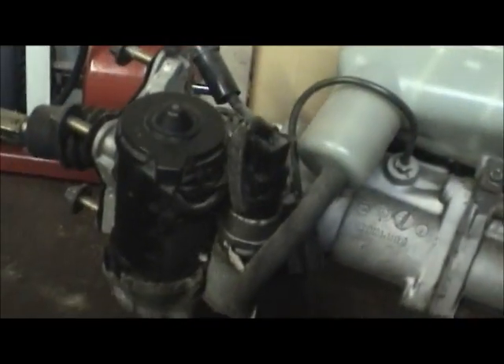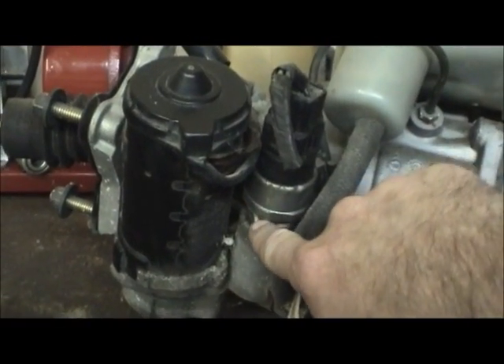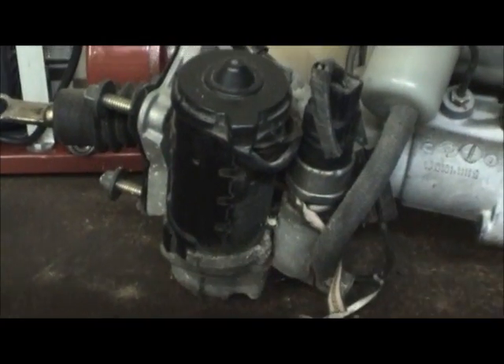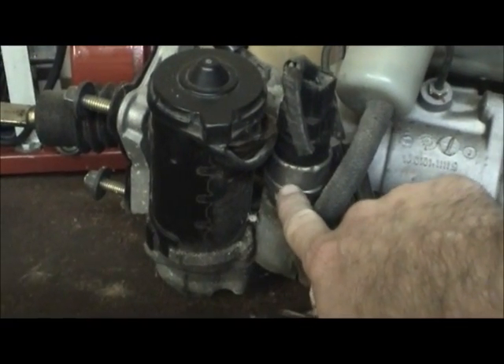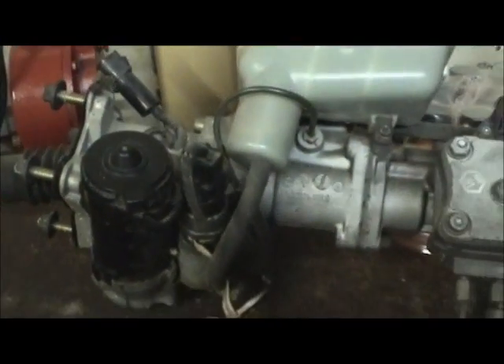Here's the pump motor assembly that builds up pressure inside, and you've also got the pressure cutoff switch. So when you first turn the key on, the pump turns on, building up pressure until it reaches a calibrated value for the pressure switch. Once that's reached, the switch opens up a relay and turns the pump off.